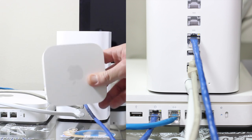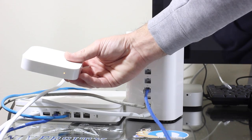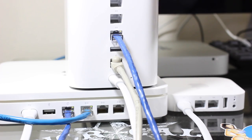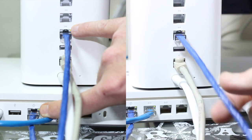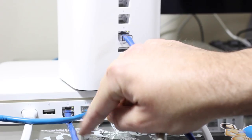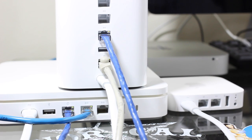We also have this base station — we're going to put that in another room. Here's our power source; let me go ahead and plug that in. It's got an orange and a green light — it'll take a second to connect. So just to recap: the base station is powered up, the Airport Extreme is powered up with that single connection from the LAN port going to the WAN port on the Time Capsule, and there's the ethernet cable feeding over to our Thunderbolt display.